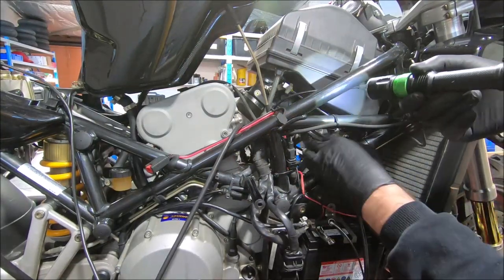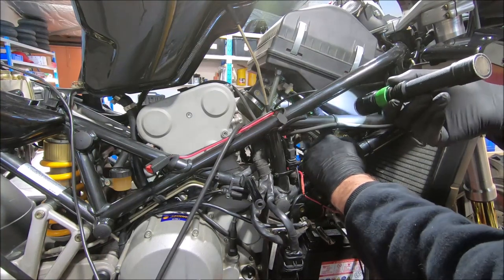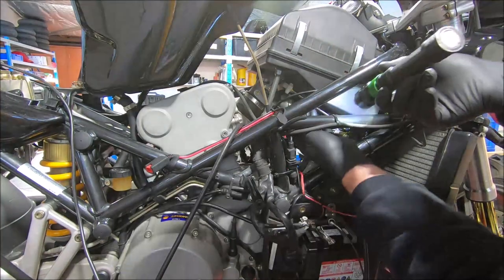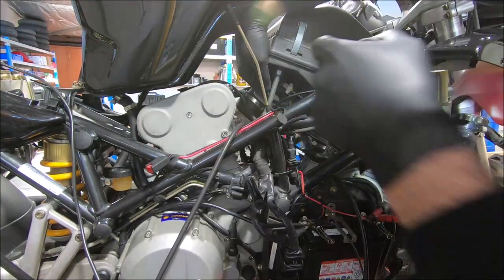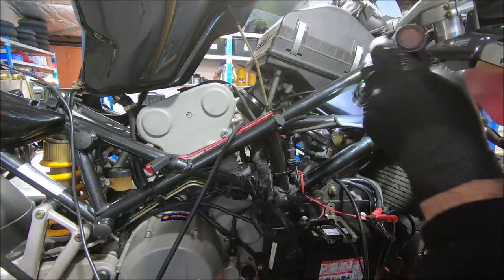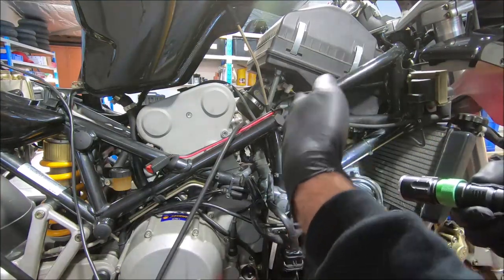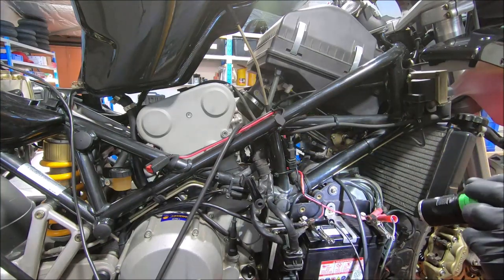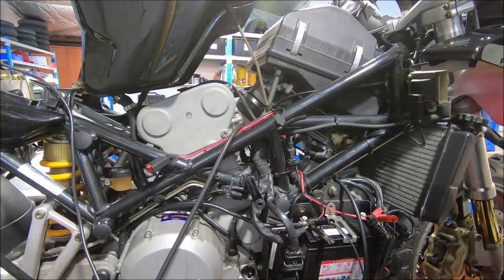Actually a flat section on this rod here that you can hold the rod. Often not a bad idea. But what's happened now, I'll just centralize that on the front. You need to make sure that the rose joint on the front is nice and vertical. If it's either way, you can affect the balance quite a bit. So now that's tight, that's probably pushed the rod a bit longer anyway.